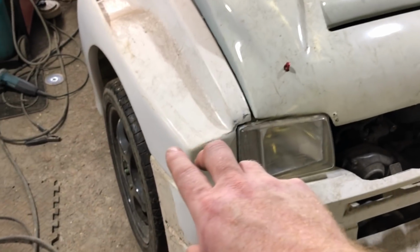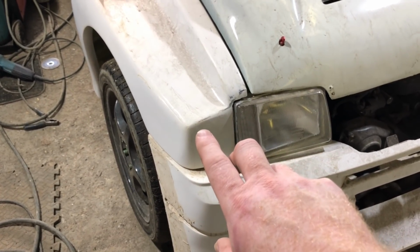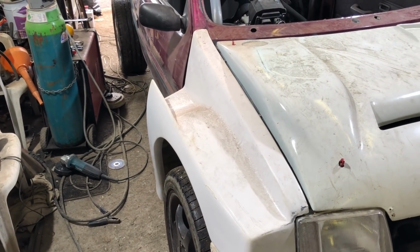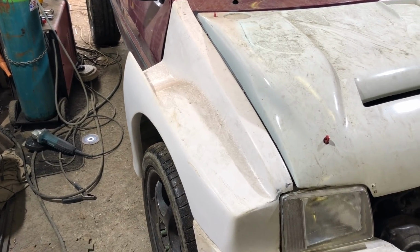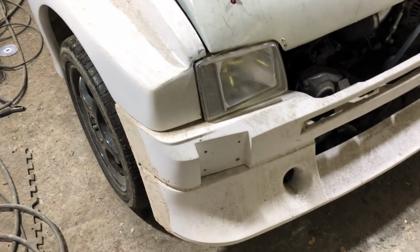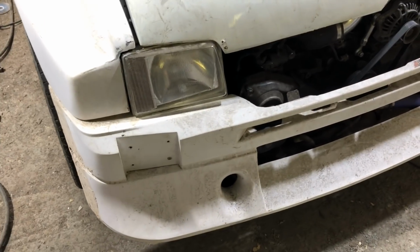And the rear and the wings. The wings are pretty standard, aren't they? I don't think we've done any mods on the wings, so they just need flattening down and maybe a little bit of filler primer. My view at the moment, I think I bought 5 litres of the damn green paint, so I think I won't primer it. Gel coat's good. We'll whack it down with 500, get loads of coats of top coat down, and the job's good. Where we've done the fillering work, we'll put some primer all over that, do our best, and just get the thing smacked basically.